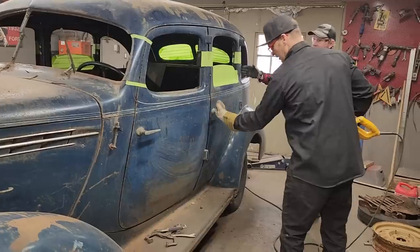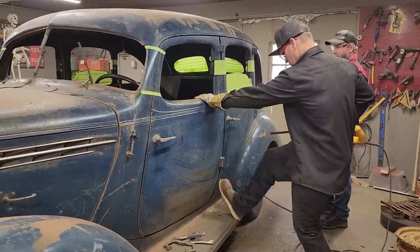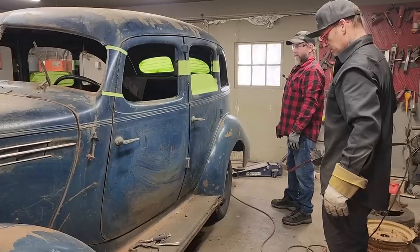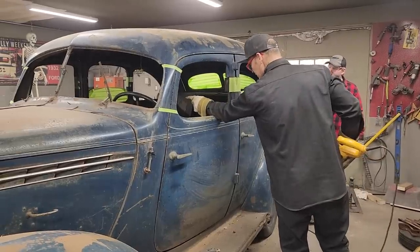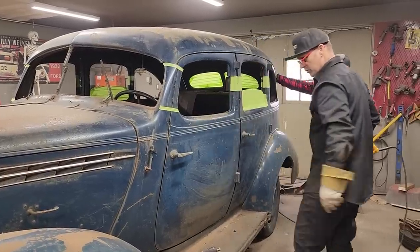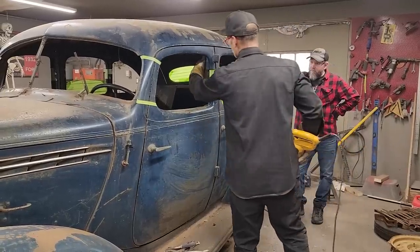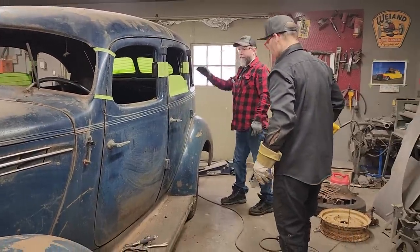The car has a door there — it probably would have been nice if I put a brace on the inside from post to post. I could have put a piece of straight rod in there just to hold it together, because it has come open there. It won't come open up here, but right here it's going to come open. But we've got a true read by the top of the roof — we'll just push it in and tack it, it'll stay. It may seem like it's moved over, but I think it's because this is moving out. We're all good.